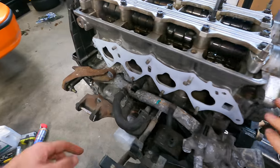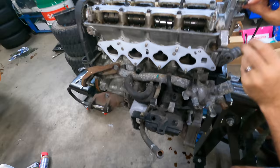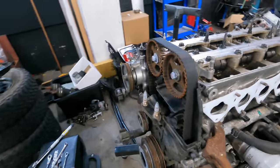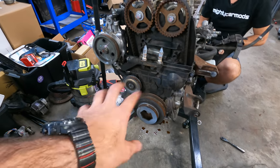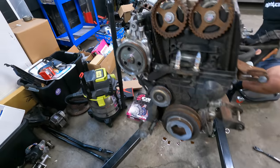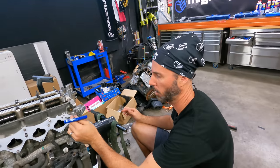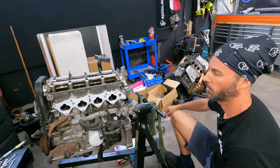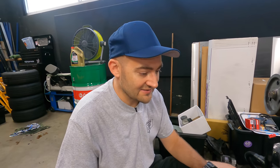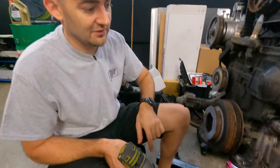The distributor blanking is done, those old bolts can go. We are going to put a new thermostat in. The hoses look to be in okay shape. There's a knock sensor or pressure sensor there. The next action is over here — I've got to put new pulleys on and also got a different balancer with the trigger wheel. I'm going to do that right now. We've also got to find out whether this gasket just is the gasket or requires some kind of sealant.